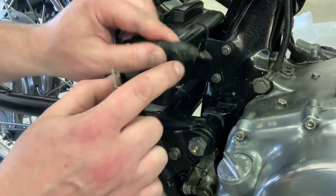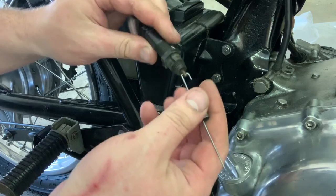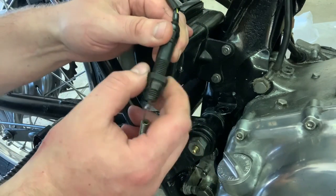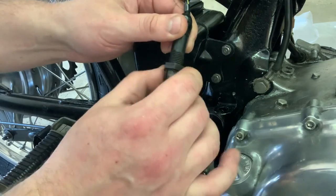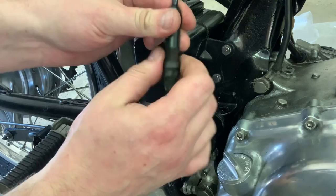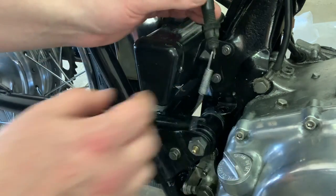If you look at your brake switch, there's a little hole here. This one actually clips in there just like this. And then this is your main adjuster. So if you need more pressure on your switch, all you do is you tighten this bolt or this nut and it'll bring this thing into position. Let's just go halfway and see.